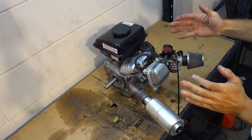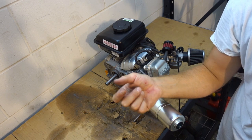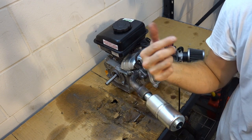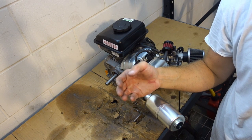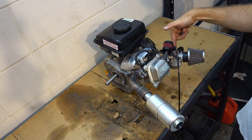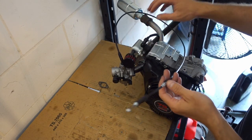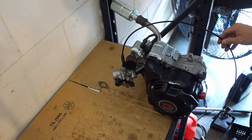So that's it — those are all of our performance mods. Number one: valve springs and valve lash check. Number two: port and polish and grinding your valve seats. Number three: shaving the head to increase compression. Number four: advanced ignition timing about 10 degrees. Number five: a high performance carburetor and a free-flowing exhaust system. Now that we've got good compression and everything back together, it's just a matter of doing a test fire to see if she'll run.